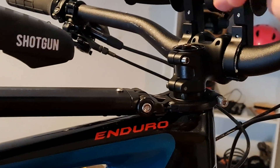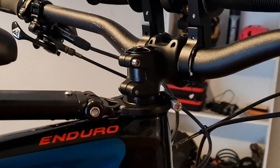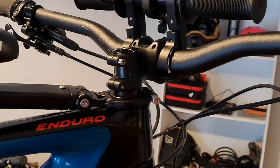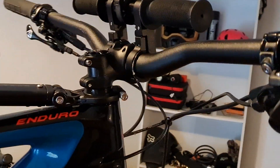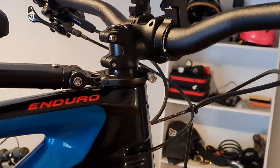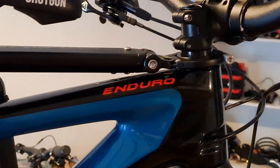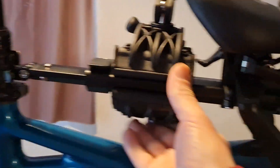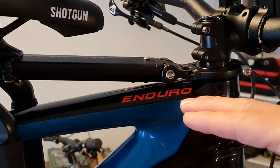It was very stiff, so I loosened off the center cap and backed off the tension until the center cap was finger tight and could spin freely, but there was still quite a lot of grinding and you really had to grab it and put some pressure on it to turn it. It is turning a lot smoother since getting back from the bike shop re-greased yesterday.